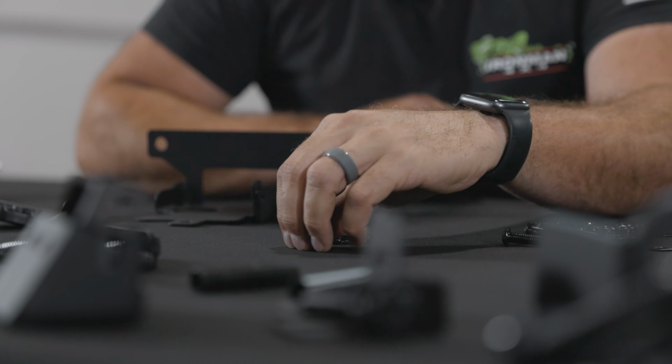Because everybody's trucks and suspensions might sit different, you might have more rake on your truck. Put a level on it. I set it at 0 degrees. Now what Ford says is if this unit is angled up, it's going to be less sensitive, and if you angle it down, it'll be more sensitive. I set it at 0. We'll go out and test drive it. If it's too sensitive, we have some adjustment. We can move it up a little bit so it's not so sensitive.